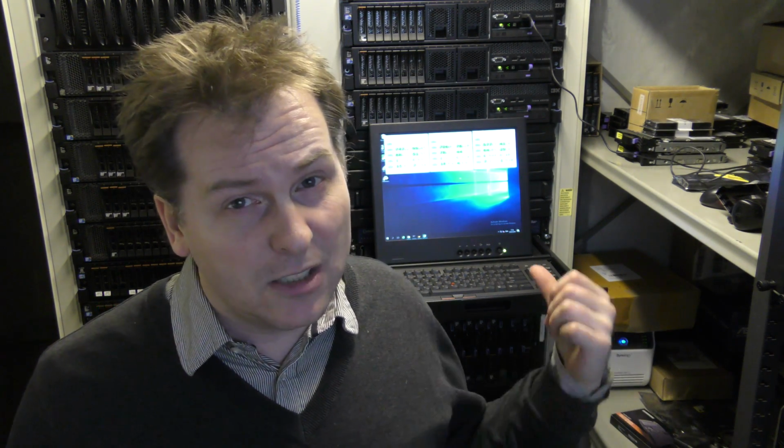Okay, testing that, I must admit I got way better performance than I had even dared to hope for, because we saw really poor output when I was trying this over iSCSI. It was so bad. But I don't know what that 1 gigabyte per second limit is. I'm guessing that it might be the SAS 6 gigabit connection, but from what I've been reading, that should actually be able to do 2.4 gigabytes per second theoretically. So probably a bit lower, but this is just about half. So a lot of stuff could be going on here, but yeah, I got better result than I had hoped for.